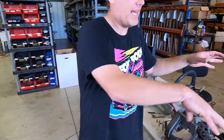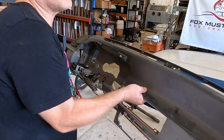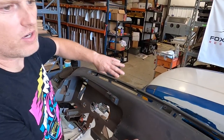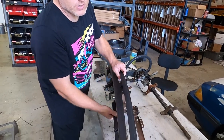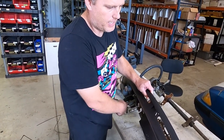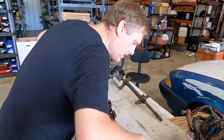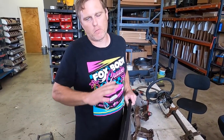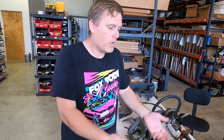You also want to remove the shifter. A lot of times guys leave the shifter in there and push up on this bezel, and they have to flex this part of the console to clear the shifter. I have personally split consoles right in half by doing that. You just do it the right way — take the little bit extra time, remove it the way you're supposed to, and you don't mess anything up. If you've got a super nice interior, the quickie way is faster but it's not the right way. You can really mess up and break plastic and interior stuff.